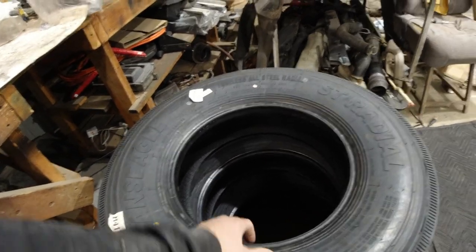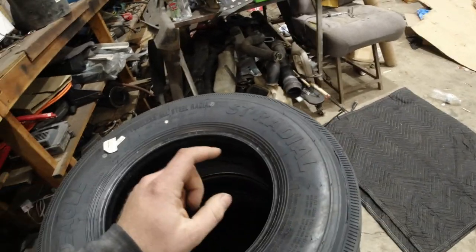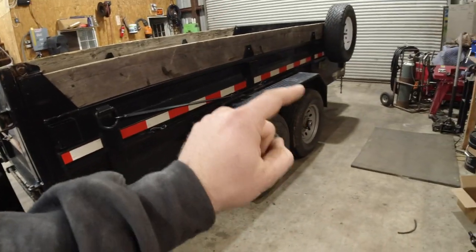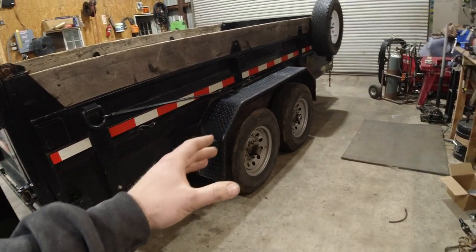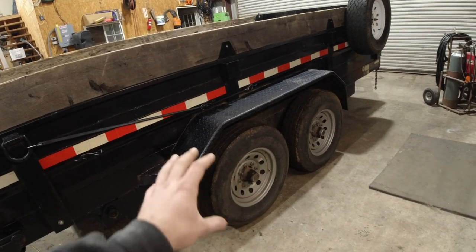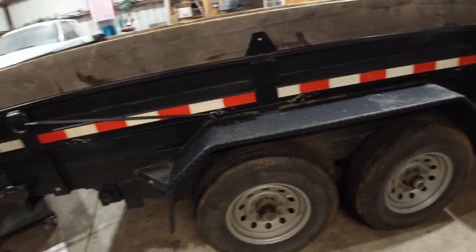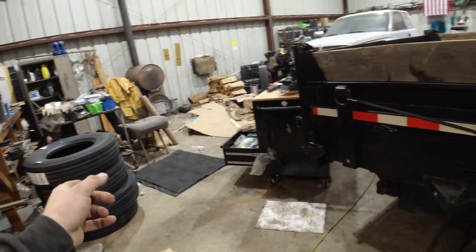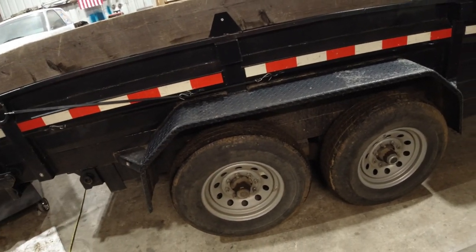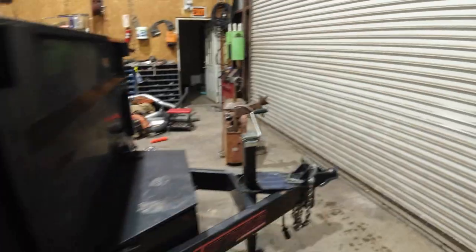What I did is I just got some 14-ply 16-inch rim size tires and we're going to try our best to get these on. They are thick — the sidewalls are super thick. The reason I like these is obviously they're tougher and they're going to last longer. Compared to the old ones, the sidewall is so weak — when you go around a corner loaded you can really see the sidewalls start to get manipulated, they just get destroyed, just getting rolled over.